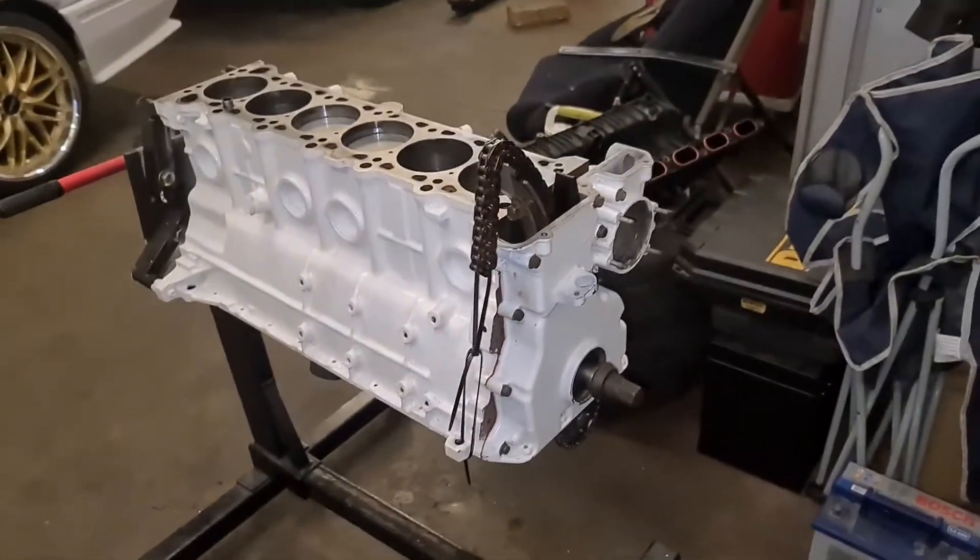Other than that, that's basically it for this week. I didn't get much done because the baffle plate slowed me down — I was trying to work out the best way to get it fitted and there wasn't much information online about what people have done. The M52 one was completely wrong so that wouldn't fit. Next is basically just to get the head on, get the cams in, get it all timed up, get the sump on, and that'll be basically it. Hopefully I'll get most of that done next weekend. Hopefully you enjoy watching — subscribe and like the videos, thanks.